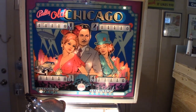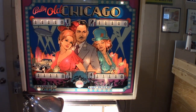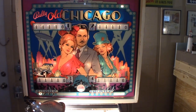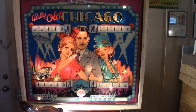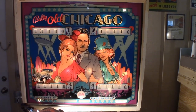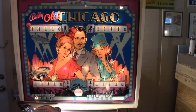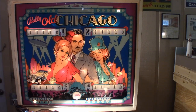Now you remember we set everything to number 1 there. So I'm actually going to do a reset for you guys here. And if everything's done right the first time around, and you hit that start button, it should go through the complete reset cycle. Have no running score motor and no coils stuck on or anything burning up. And if you can get through that, then you know that you're ready to go and start working on the playfield, because you've taken care of a major phase here.